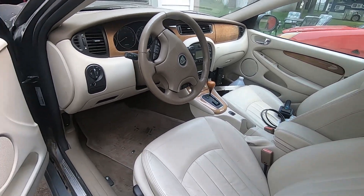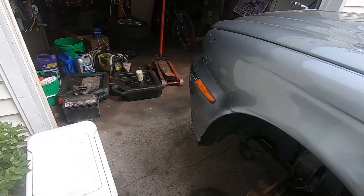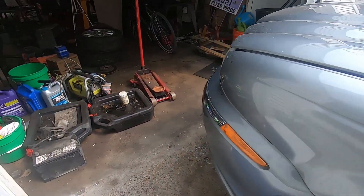It's hard to get rid of this car - it can be fixed, it's going to take some work. The door panels will have to come off and there'll be some welding to do, but all in all it's the only rust on the car. It's a standard issue for 2002 to 2005 - they had that problem. The under part of the rockers rust out. I should have looked at it but I didn't. The good thing is it's just the outer part of the rockers - it rotted out, just fell apart, a whole trash can full of it. Once we get the outer completely off we should be able to put new structure back on, get it welded in, get it in primer and painted, and this car should last a long time.